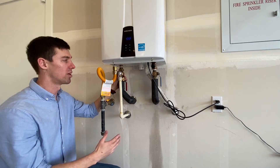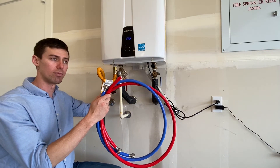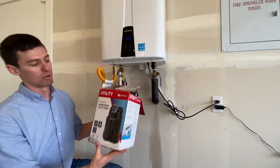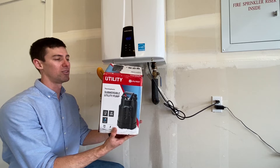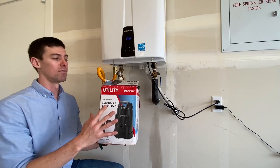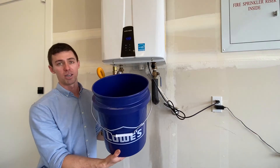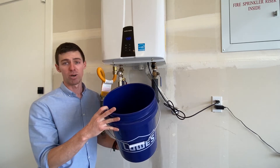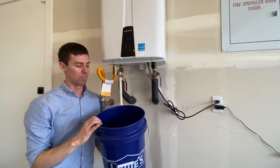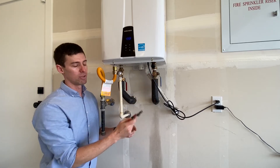If you do have them, that's great. What you're going to need to start flushing is some washing machine supply lines — I picked these up at Lowe's. You've got the cold and the hot. You're also going to need a submersible pump — this is the one big ticket item. I got this at Lowe's for about $140. It's a basic submersible pump. That is expensive, but if you think about all the time and money you're going to save flushing yourself, it's worth it. You're also going to need a five gallon bucket — I'd recommend getting a new bucket so the inside is as clean as possible. You don't want debris going through your submersible pump and cycling through with the cleaning solution. And last but not least, you're also going to need a pair of channel locks, because sometimes these nuts can be a little tight.